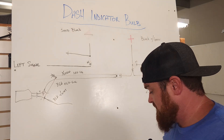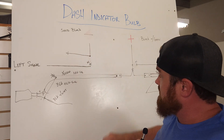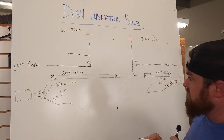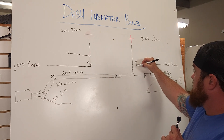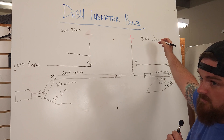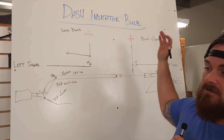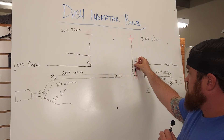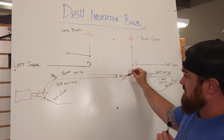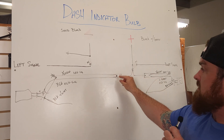Let's go over this one last time to make sure everybody gets it. The bulb on your dash for your turn indicator — that was once a positive — we've made it a negative by running it to a ground with the supplied black wire. The wire that was connected to the bulb, leave it — put a little wire nut on it if you'd like, tape it up with electrical tape, it's done. Same thing with the other wire coming off the bulb — black with green stripe at least for me. It doesn't matter what side you start with, just pick a side. Bring this wire in — our diode next to that wire coming off — you can solder them, use butt splices, crimp it.